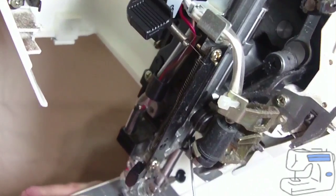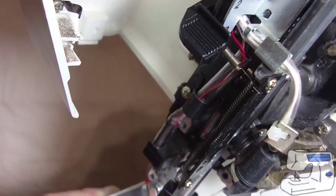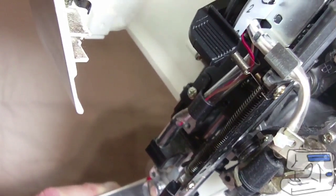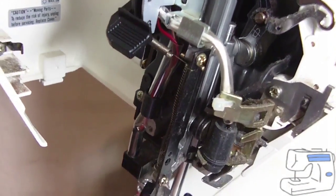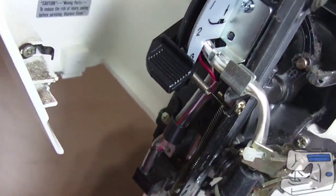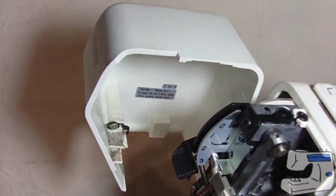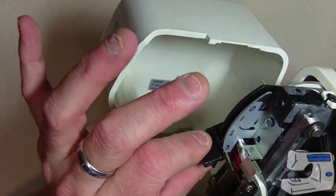And so I go through it. I turn the hand crank, and any place where I see metal on metal, I get it in here. Right here is metal on metal. Needle bar. Usually when I do a service, first thing I do is grab the air compressor and blow all the fluff out. And I'll be doing that momentarily. And adjust things like your needle threader. This machine here has presser foot pressure, 3 levels. 0 should be nice and loose and sloppy. 3 is max.